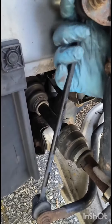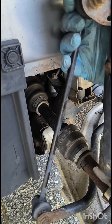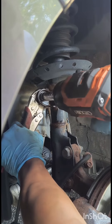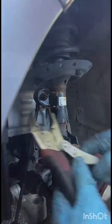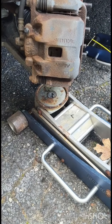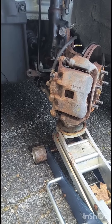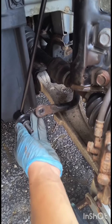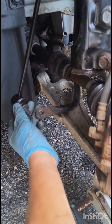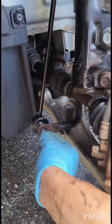Now move to the opposite side — this link is dancing with the dead right now. If you don't care about the boot's integrity, you can use a pair of pliers to break it loose. Here's the new one, and repeat the same methodology as on the passenger side. Jack up the suspension and make the links fit into the holes of the sway bar and the strut, then apply medium strength blue thread lock.